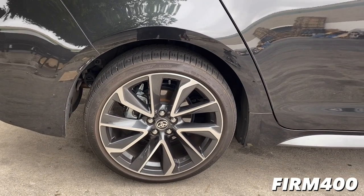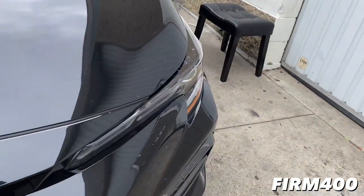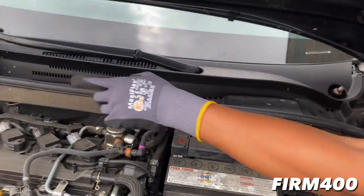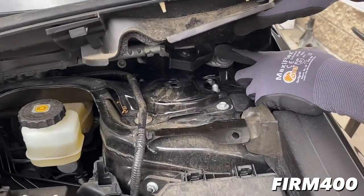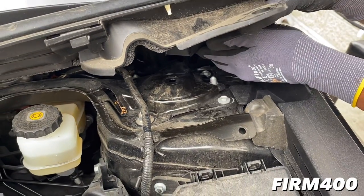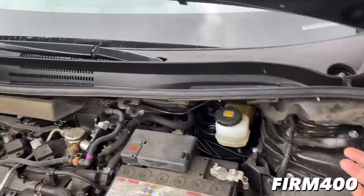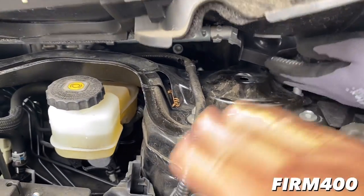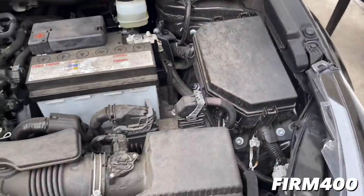The rear is finished, Jesse is now going to be doing the front. The front is a little bit different - there are four clips and I had to remove the driver's windshield wiper just to get access. So I've got to remove this bolt to get access to that bolt in the rear. The fronts are tricky on these cars because you've got to pull out multiple things. The way Toyota designed the new model Corolla, they kind of compressed it, so you have to take out the weather guard and remove this bolt for the windshield wiper. Just lift this up and you have access to grab that rear bolt right there.